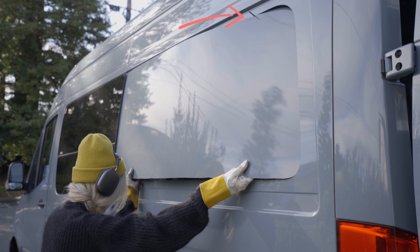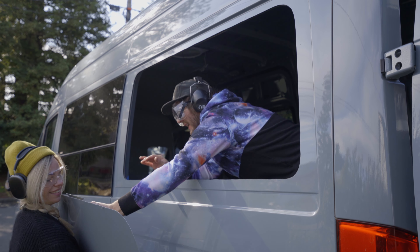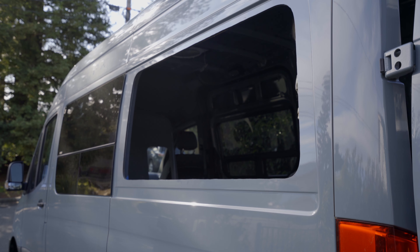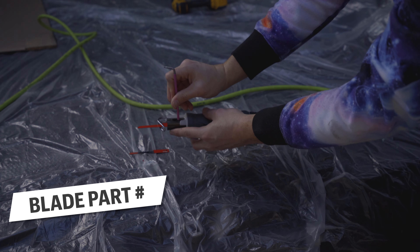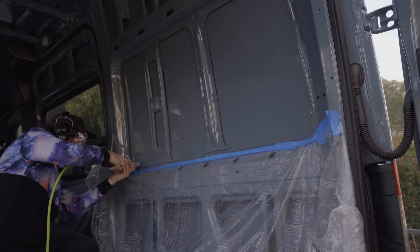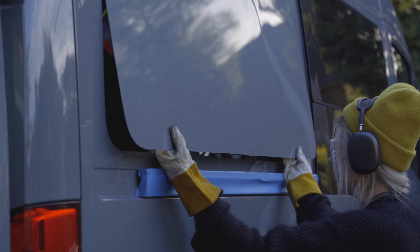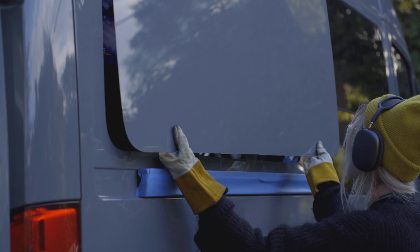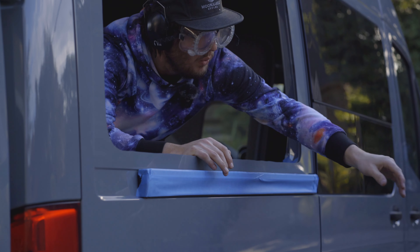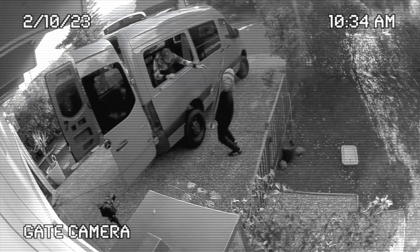With a little tab left on the panel from the top, I have my lovely assistant hold the panel out from the van on the bottom. I finish the cut with one hand and hold the support with the other, passing it down to her after it's free. We change our blades after each cut, and we've found that the name brand 32 teeth per inch blades work best. We simply repeat the process for the passenger's side. When handing the panel out to your lovely assistant, be sure not to let it go too early - luckily no lovely assistants were hurt and our security cam picked up the party foul. Clearly a mistimed handoff and boom goes the dynamite!